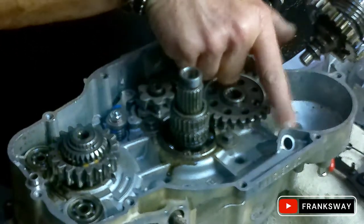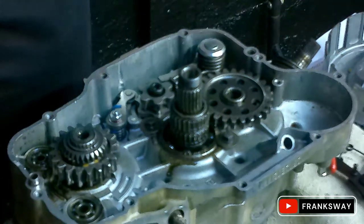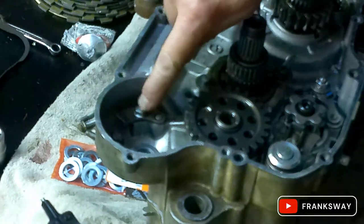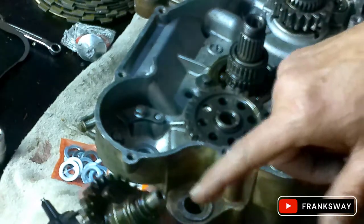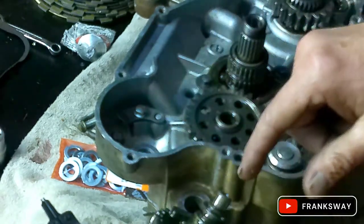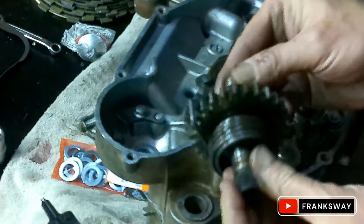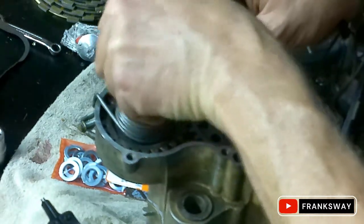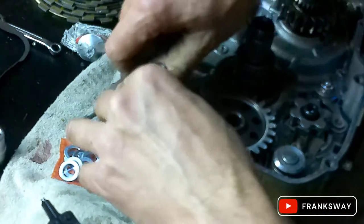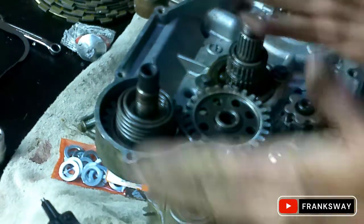At the back there's a plate around the corner here. Let me set this up differently - we'll bring it to a different angle. Just for demonstration purposes: there's a little plate here, and your kickstarter shaft has a little notch that goes in underneath. Then you'll see your spring goes in here. Let's quickly do that, line it up. That is in. We bring the kickstarter spring back. Done.